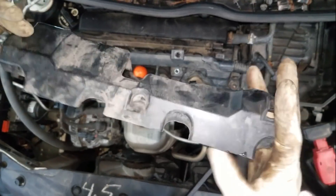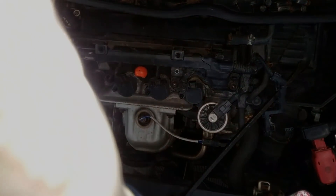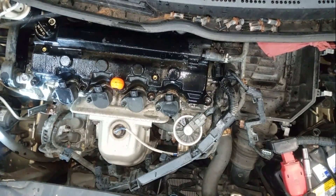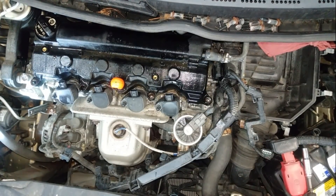This is just a little plastic cover that sits on the back of the valve cover — it kind of protects the fuel injectors. We're going to be adjusting the intake and the exhaust valves on this. The exhaust valves are in the front where the exhaust manifold is, and the intakes are in the back where the intake manifold is.